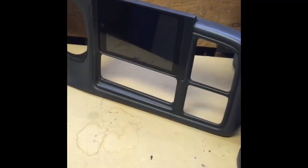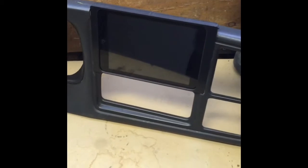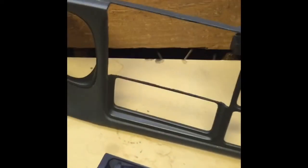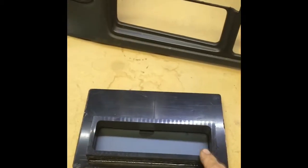Here is an O2 Chevy dash bezel that we're building. We already cut down our iPad mini kit and cut the dash bezel to fit it. We separate these here — you can see there's the cut in the bezel. In this particular one we're going to be doing a radio mount, so we already have our built-on spacer on the back of the kit for it, and we're going to bond these two together.